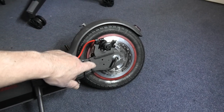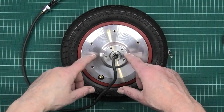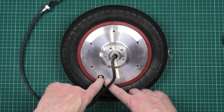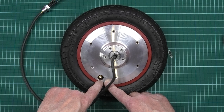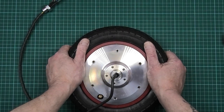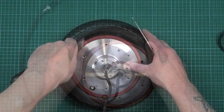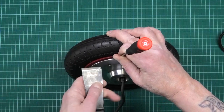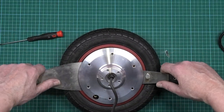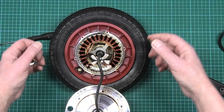Whether I'm ever going to be able to test this thing I don't know. This isn't straightforward to actually change the tube if you put one of these hubs on or disc adapters, because I have to take this — there's a little retainer in there that has to come out and I obviously can't get to it, so this has got to come off. I put the nut on the other side to protect the threads, then whack it down as hard as I can on the floor and it pops it out.